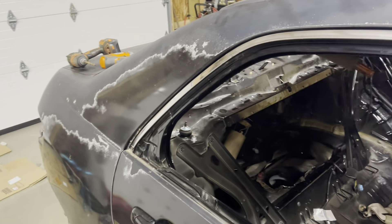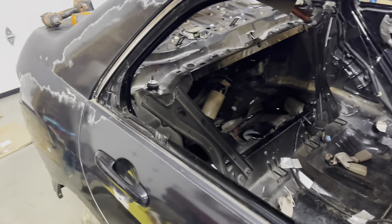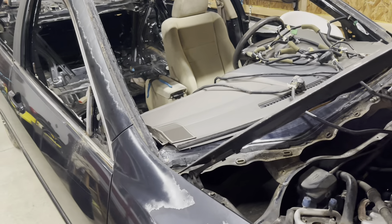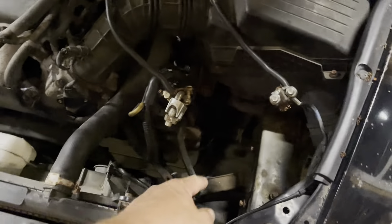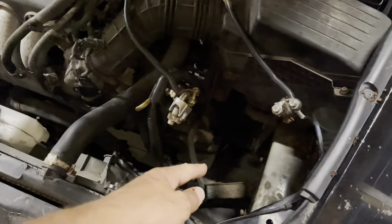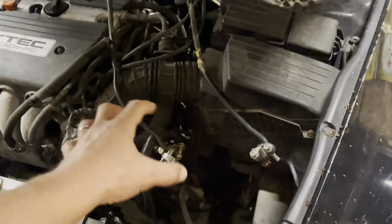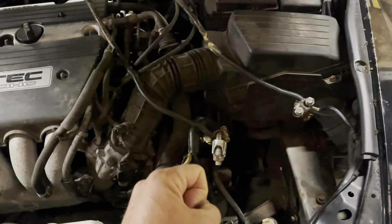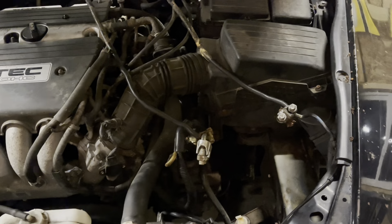Only thing left is to press the trunk up with a jack and secure our lines — extra lines I'll tape off. Up front, the transmission line loop is there; I'll electrical tape those good and secure them so they're not wiggling around. The negative is right here, positive there — use a u-bolt clamp down through the terminal. You don't have to cut them when you can get a good grip with those.